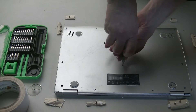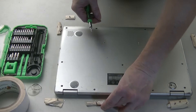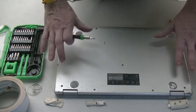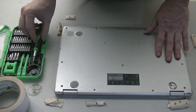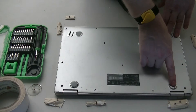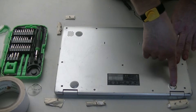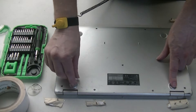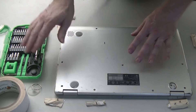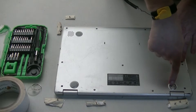The one in the center — we want to lay him down on his side. See how all these are standing up? We want to lay him down so we remember he's the one that goes in the center. Now after you remove all the screws, on this particular one it was missing a foot pad, but normally you'd have one here. On some models you have to remove both foot pads using a pry tool or flathead screwdriver. On this model there's only one screw under the one foot pad.